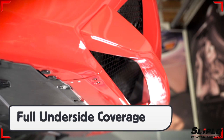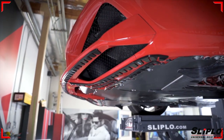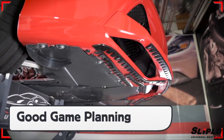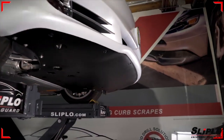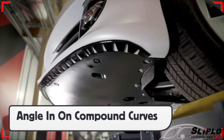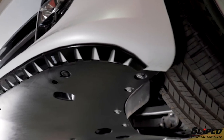For primarily exotic vehicles, the underside will require full coverage. This means more time in planning, more Sliplo strips, and more install time, so be sure to price and schedule accordingly in order to achieve symmetry and protect all areas. Some bumpers will have a rounded front with an indefinite compound curve on the sides. Here it is critical to feather the Sliplo down and build from the sides, using the self-adhesive templates when necessary.